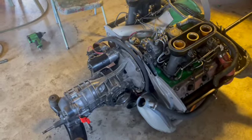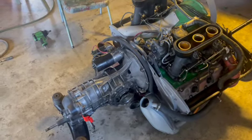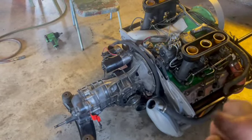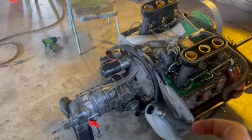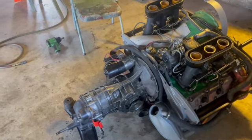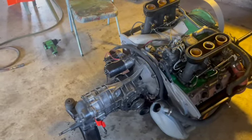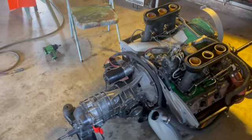And so after I pulled it off, I checked the splines on the clutch, they're good. Held the alignment tool on there real good before I torqued up the pressure plate to 16 foot-pounds today. 16 foot-pounds on the pressure plate. I knew I was on the money.